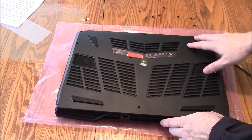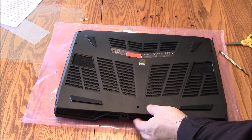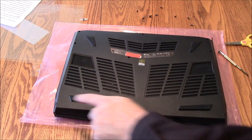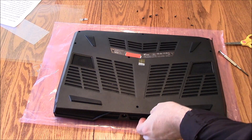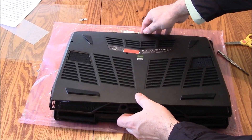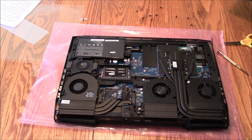Okay, well I finally figured this thing out. A little tricky, not as easy as most Clevo laptops I've used. But either way, let's remove the 9 screws. This is snapped in in the back, so you lift up here. It's also snapped in in the front, so you lift up here. And voila, you've got your laptop.